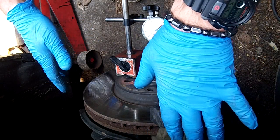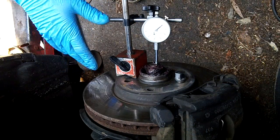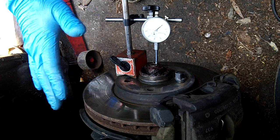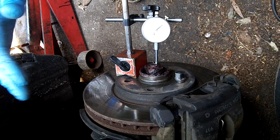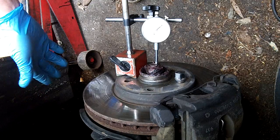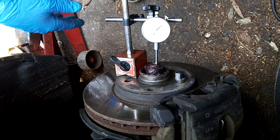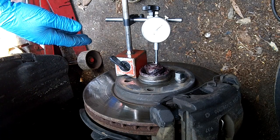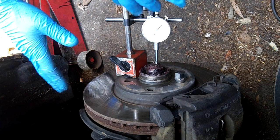The specs are all going to be different for wheel bearing looseness. What I'm doing is measuring runout, wheel bearing looseness and tightness. You can do this by hand — I've done it by hand for years and years. Sometimes I use a dial gauge, sometimes I don't. Usually you can get it pretty dead on without one.